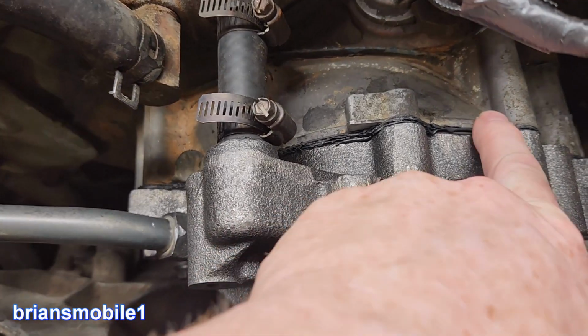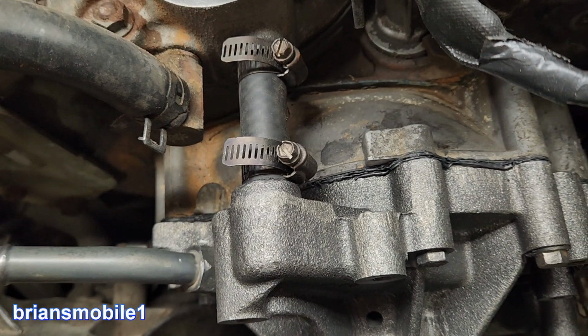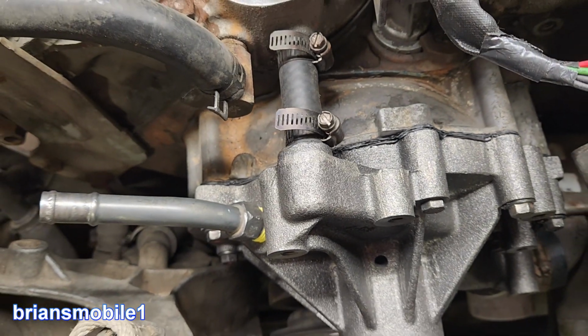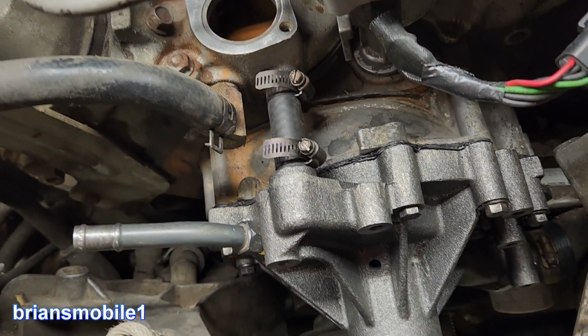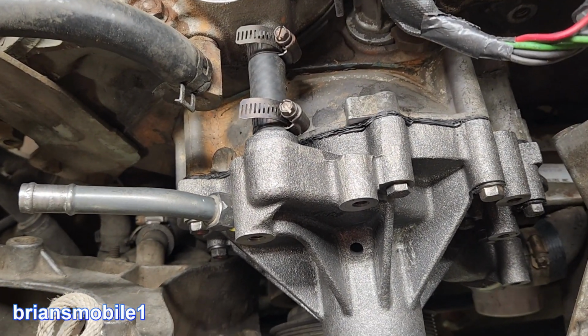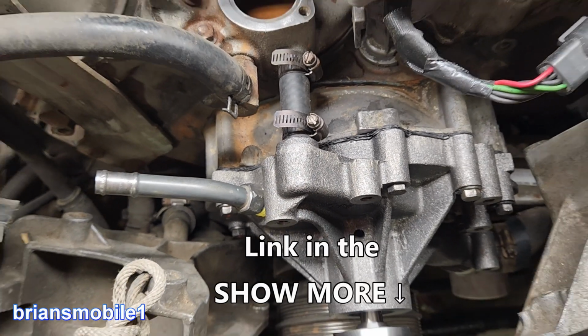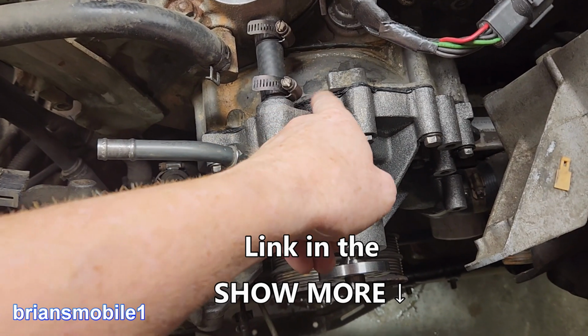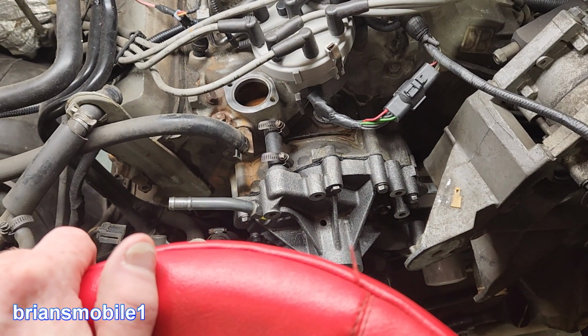If you don't glue your gasket to your backing plate into your other gasket, because there's 2 gaskets, one on each side of the backing plate, you'll have trouble getting all the bolts to go through the holes. So this thing's a whole juggling act as it is. So gluing it in place with it still wet. I like the Permatex Right Stuff for many reasons, but not least of which is that it's already got a lot of drag and friction to it, so things stay in place.